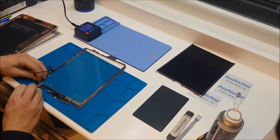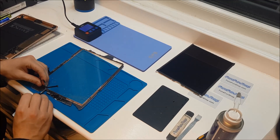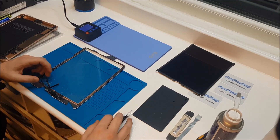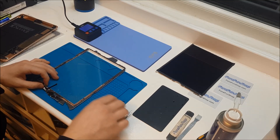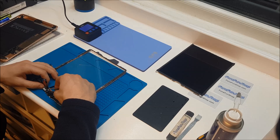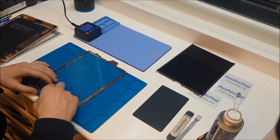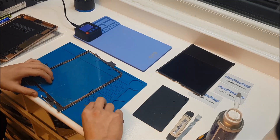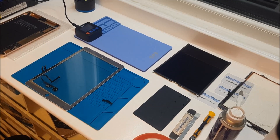You just need to be very careful — if you tear or cause any damage to the button, that Touch ID function will not work anymore. With this glass being cracked it should make it easy to peel away. So that's been removed from the digitizer. Now we've cleaned up the iPad and got it all ready for a new digitizer.